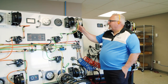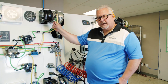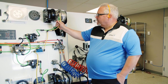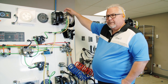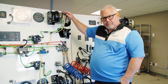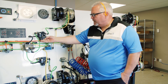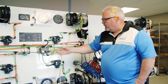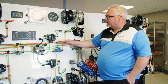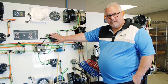What was that? Yeah, this is a not-so-common failure that can really throw the technician for a loop when they're troubleshooting. What's happening here is we have a leak between the chambers — between the emergency and the service chambers — that shows up in the modulator valve and the relay valve and the exhaust. So typically a technician will go: the modulator valve is bad, so let's replace the modulator valve.